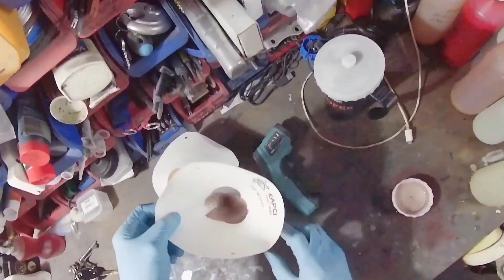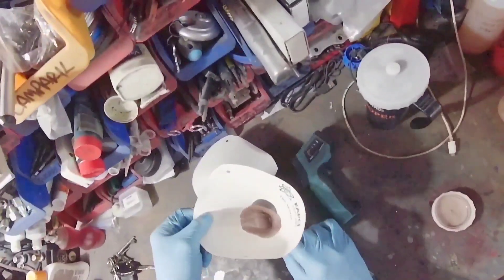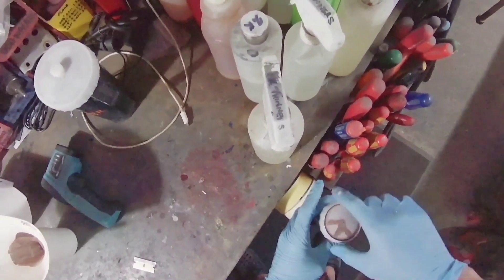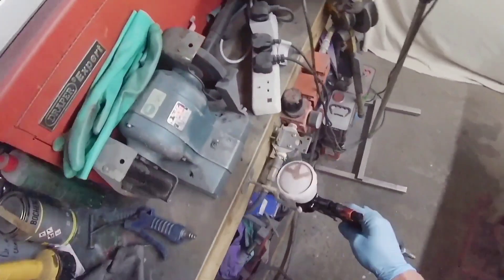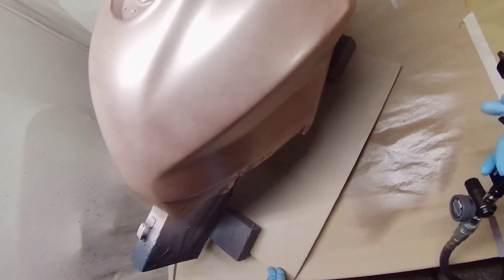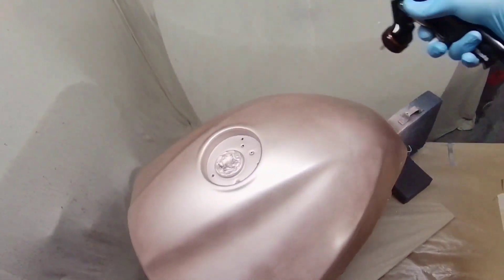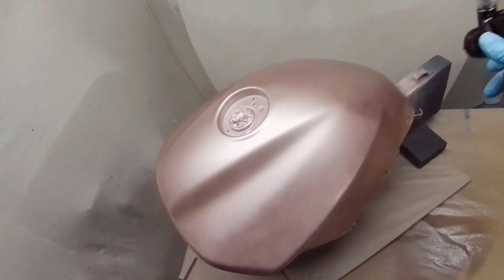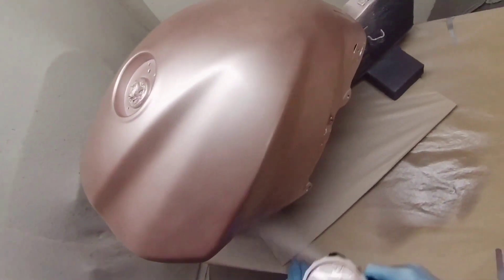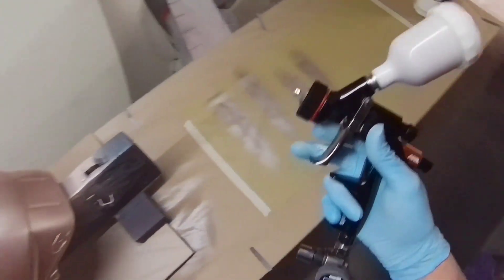The settings I used: for the base coat I ran it at two bar. The recommended setting, loosely interpreted from the original DV1, is around two to two and a half bar. I used two bar for both base coat and clear coat and it worked perfectly well. I didn't use it on full fluid at all — for the base coat I had the fluid turned all the way in and then backed out two full turns.